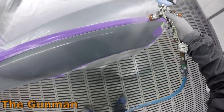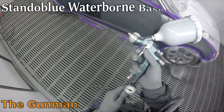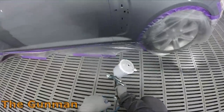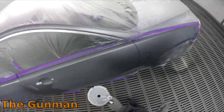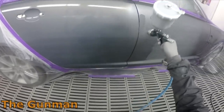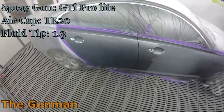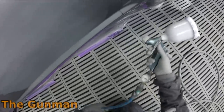Anyway, enough rambling on my coffee high — let's talk about the job. I gave it a good mask up, wiped it all down with the waterborne cleaner, then wiped down with the tack rag and a bit of air from the spray gun. I used my NSI water-based base coat blender — all that does is fill in the prep scratches and help you do your blend. It looks a bit funky when wet but when it dries it just magically turns the right color. I've been cranking the pressure down to about 1.3 bar when doing my blends.